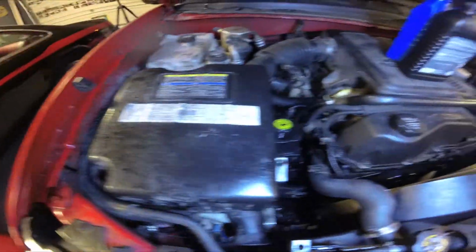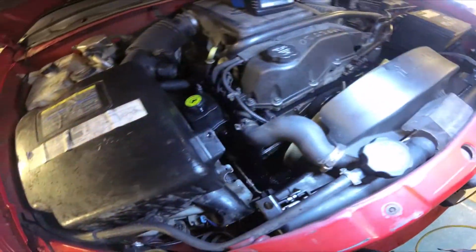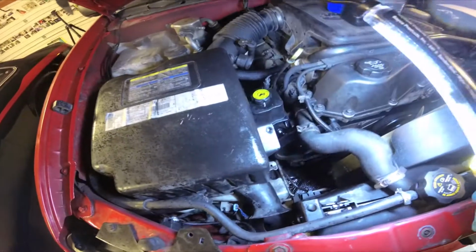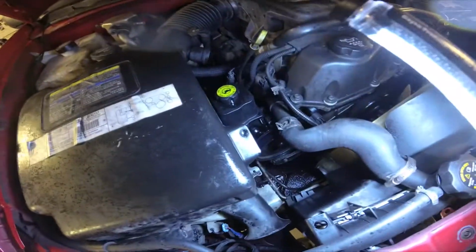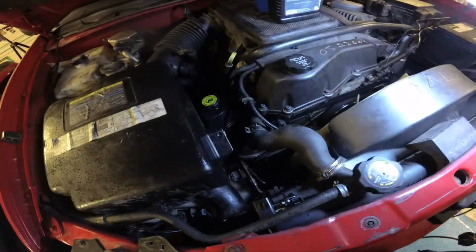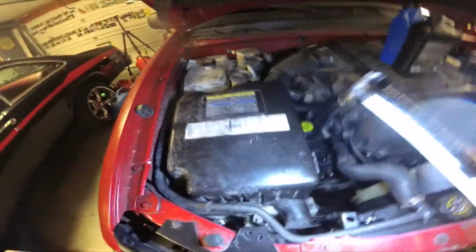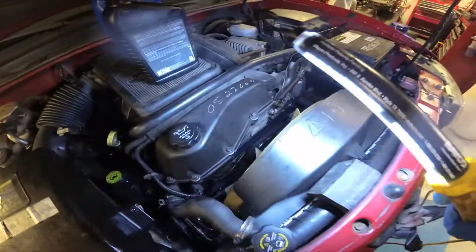Well, we're going to end this video here. We've got a hose rubbed through down there somewhere after we got the pump on. It's probably what burnt the pump up. It had a busted line. I just want to show how to change this pump. We'll have to go through and diagnose what the rest of the problems are and maybe put new power steering lines on it. We done went through 2 bottles and it leaked it out, sprayed it everywhere. It's not coming from the pump or any of the lines on the pump, somewhere into the bottom of the radiator.